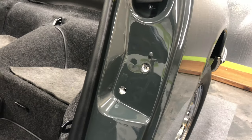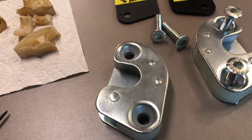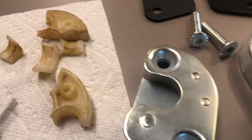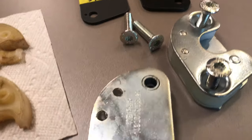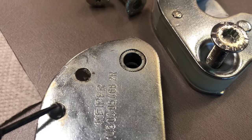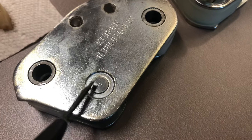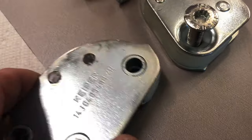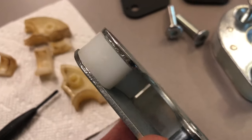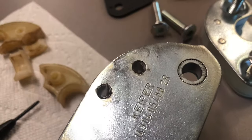Let's go ahead and move on — get our door strikes put in and then we can wrap up these jams. A close-up look at our door strikes: I bought a new replacement kit of internal parts from Stoddard that fit really well. To take them apart, there are two pins from the outside with heads on them — from the back side you'll have to drill out that pin until it's free, then drift it out from the front. Once those are out, the mechanism can be pivoted. The center dowels come out and the whole thing will rotate, staying together by one pin, which gives you access to the internals. Switch those out, rotate it back, drift your pins back in, everything lines up, and epoxy them back in.